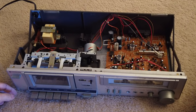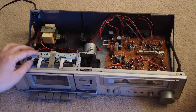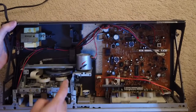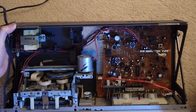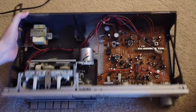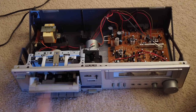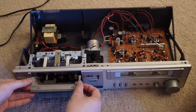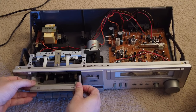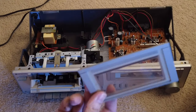So the first thing we need to do is take the mechanism out for better access to the belts. I'm not sure, maybe you can just change it like this, but the space is very tight. But anyway, I think it's easy to take out. To do that, first we need to remove the cassette door. Just open it and pry this up a little bit and push out. That's it. Take out the door,